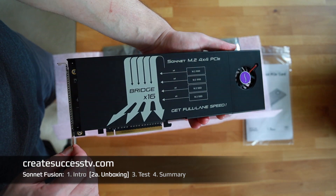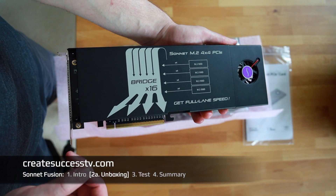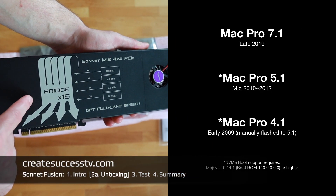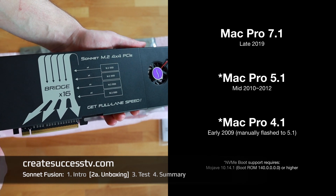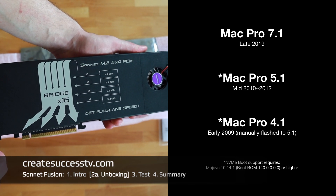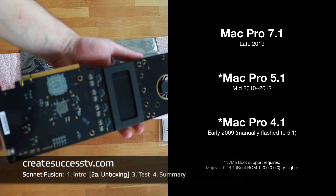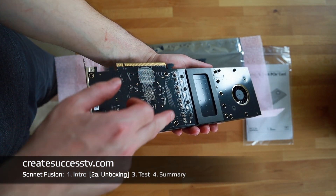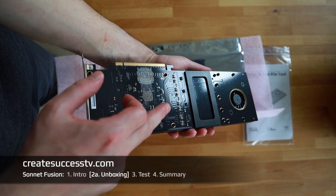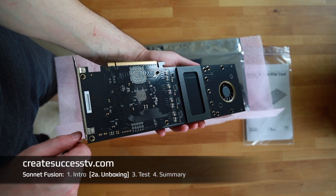You can put up to four NVMe drives in here and the PCIe switch translates this to multiple lanes. One thing I also read: if you have the Mac Pro 4.1 or 5.1 — I have the manually flashed 4.1 running as 5.1 — this should also carry over to the new Mac Pro coming out in September, so you can take this card and put it into your new Mac Pro 7.1 system. You can see in the PCB the lines carrying data to the PCIe switch, giving you four lanes PCIe 3.0 split to eight lanes PCIe 2.0.